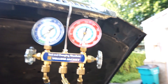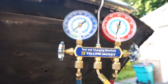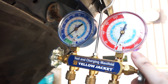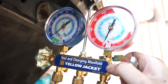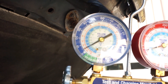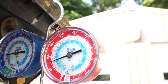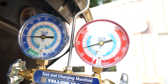So what we're going to do is pump nitrogen into it and see if there are any leaks. I've hooked up nitrogen on the yellow line, with the blue and red lines connected to the car. I'm just going to crack the valve on the high side, which will allow the car to pressurize. The low side should also come up in pressure as it circulates through the system. I'm going to lock the valves down and then leave to go vote, and see if we still have pressure remaining.